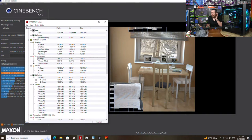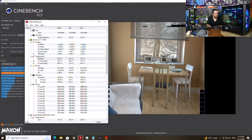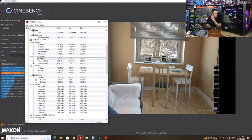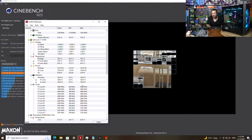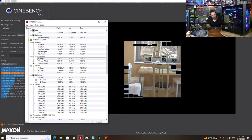And then yeah, this is satisfactory for the stress test. Because I just want to make sure it gets nice and warm inside the case. It's not about trying to make the board die or make the CPU die. It's just about running a bit of power through it, getting it heated up, allowing it to cool back down, and me to turn it back on again the next day, and everything will still be sweet. And that's a pretty good indication that I'll be able to ship this off and it's going to be fine for Mark when he goes to turn it on.